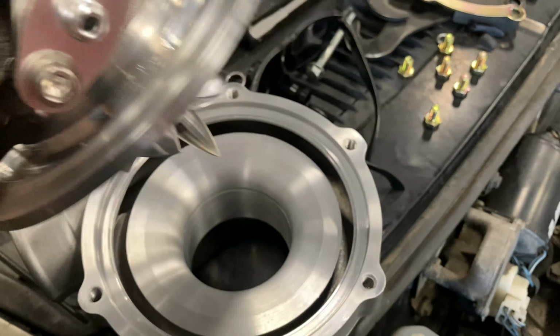Okay, so all the rear housing bolts are in, and as you can see, the feed line is coming out of the block into the top of the turbo. So now we're gonna do the drain line that needs to go right there and go into the bottom of the turbo over here, and that'll complete your feed and return line for your oil system for your turbo.